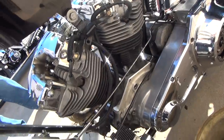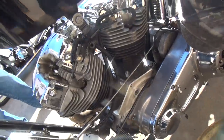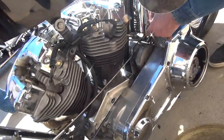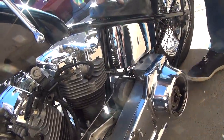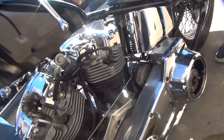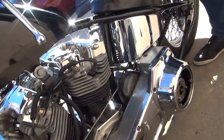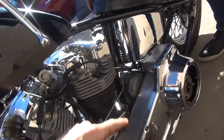I'm soaking up length. The problem is the rod's too damn long. What if I took it off and just hammered it? I'm thinking the throwout bearing is bottoming out inside your cover somehow. Something's not right in that kicker cover - I don't know what it is because I didn't put it together. Because your lever's not even bottoming out against the tranny lid like it should be when you pull the clutch.